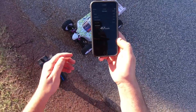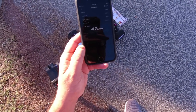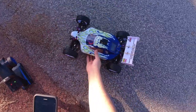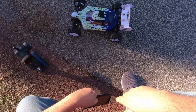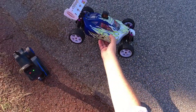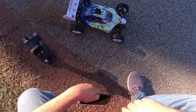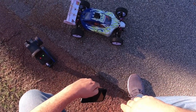Got 47kph on this combination. With the stock brushed it was 37kph, so a 10kph gain on 2S, and an 11kph gain on 3S — 65 instead of 54. It runs a 3650 3900kV motor with that claimed 120 amp ESC, whole combination around 40 bucks. Definitely don't think these are 120 amp ESCs — should have got a better speed than that. Next time I'll put a Surpass Hobby ESC in and we should get closer to what I was getting with the 104001.